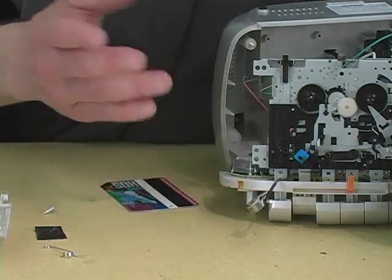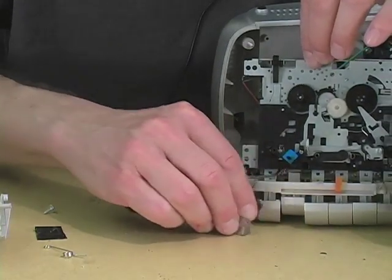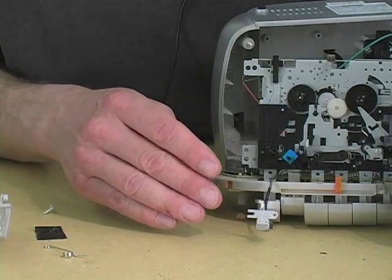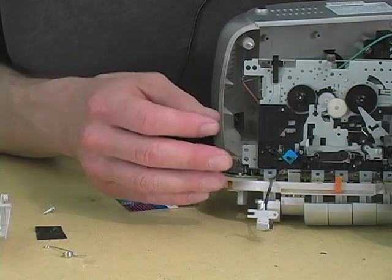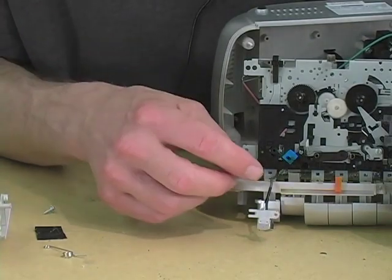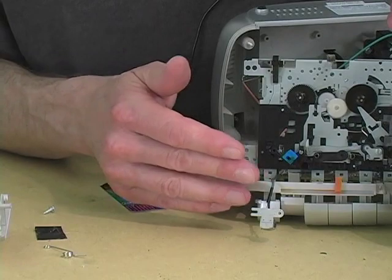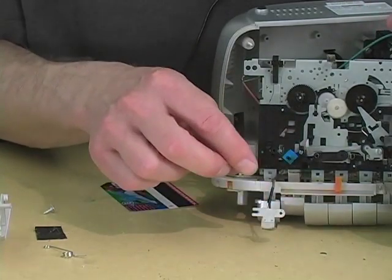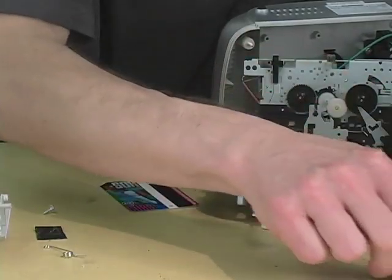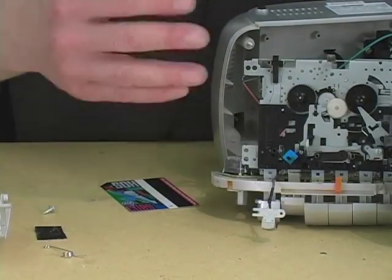Transit cards all sound the same more or less, but if you take a cassette tape that you've recorded something on, place it along the table and rub the head across it, you can do essentially the tape equivalent of turntable cutting and scratching. Even a rather cheap boombox has a much better designed preamp for the tape head than just sticking it into the front end of a mixer or a little amp, so you can actually get a reasonably good sound out of it. And most importantly, if you haven't completely destroyed the device by opening it up, you can record this way as well — put tape down on a table, plug something in to record or speak into the built-in mic, move the head across the tape or sideways or backwards, and essentially make a semi-linear back and forth method of recording.